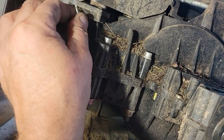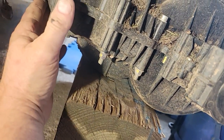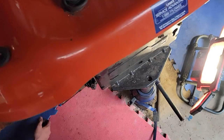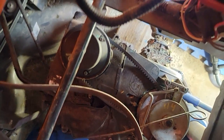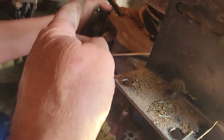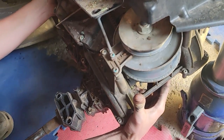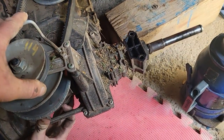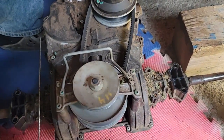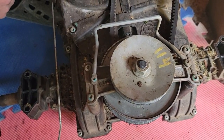Reach under there — it's a safety switch. Now it looks like we can bring this transmission right down out. Dawson's going to keep jacking it up and we're going to look this over — maybe it would be nice if it's just debris under there. Push the little release lever — it's getting a little stuck, make sure it goes through without binding. We're going to jack this up and pull this out. I don't think the transmission weighs very much — Dawson lifted that lever up, I disconnected the wire, nothing's in the way. Release the free wheel, pull this out. About 20 pounds — bring it straight out.